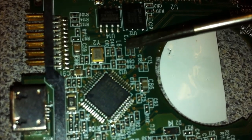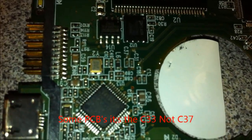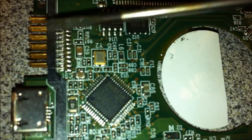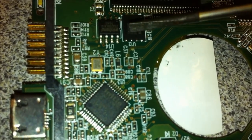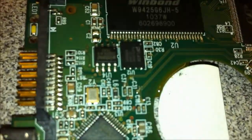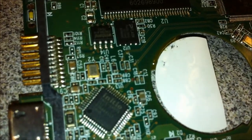So now I'm going to be removing the C31, C37, C13, and C18 capacitors, which are going to be disabling the USB controller - otherwise it just won't work. I know a few people with other issues were talking about replacing the crystal, which I haven't done before on one of these drives. And if you're switching boards from another drive, you've got to change the U12, and some people won't see the U14, but normally that's only if your drive's completely dead and not spinning up. This case is just a USB issue.